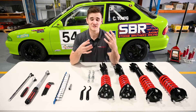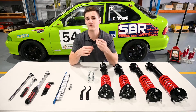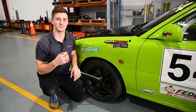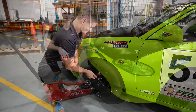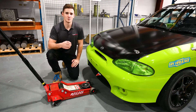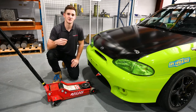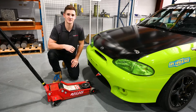To jack the car up, we've obviously got the trolley jack you can see behind me, and you can either use two or four jack stands. To start off, we'll be loosening the wheel nuts, so you need your vehicle in gear, handbrake on, and you need your breaker bar. As always, safety is paramount when we're lifting a car to work on it. Make sure you've got a rated jack and jack stands. Your wheels that are touching the ground are chocked and you're lifting from a sensible jacking point.